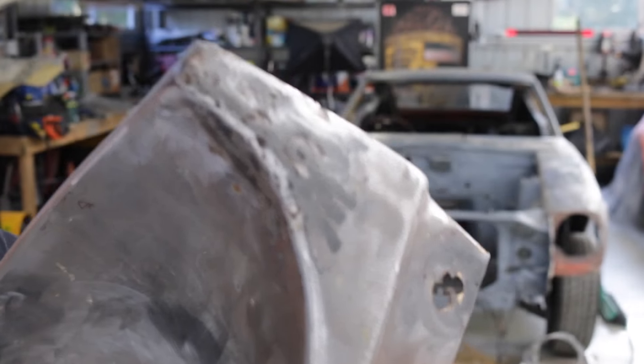I've still got to use it on a few more bits and pieces. This was a particularly difficult, stubborn dent that was really folded in, so it needed quite a lot of pressure to pull out. I'm thinking even most stud welders would probably keep popping the studs off, so I have to work around it and do little bits and pieces. There's still a fair bit more work to do, but overall my homemade stud puller — I'm quite happy. Little tip: I used galvanized nails and I did grind off the tips to get rid of some of the galvanizing so they'd weld a little bit easier. Non-galvanized would probably be better, but overall the DIY stud puller works.